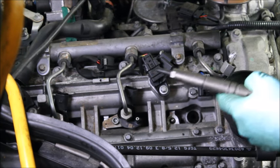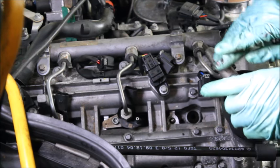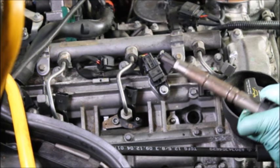This is what the injector should look like once you've cleaned it up. Here I'm applying some copper grease so it won't bind as easily again in future. You can use copper grease, but it's important not to get it down into the sealing area. A better grease to use would be ceramic grease, but I had copper grease available and it is suitable as long as you keep it away from the seal.